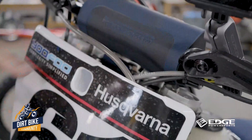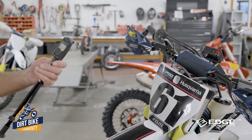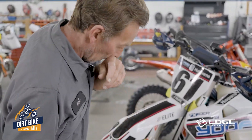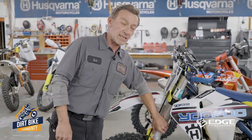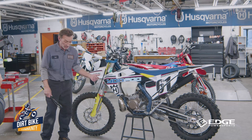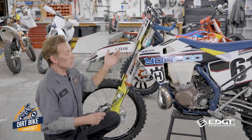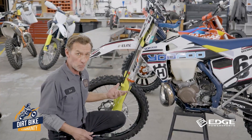If you've got an air suspension setup, you're going to screw your air pump onto that little nodule right there and turn your pump on. One trick on the Husqvarnas, KTMs, and Gas Gases: you do want the front tire off the ground when measuring. The fork needs to be fully extended — there's a detent port inside the fork, and if it's not fully extended, air doesn't bypass through there properly and the chamber fills up weird.